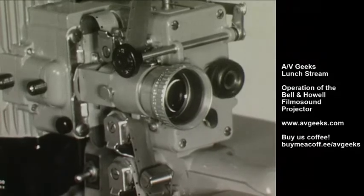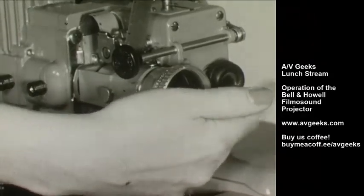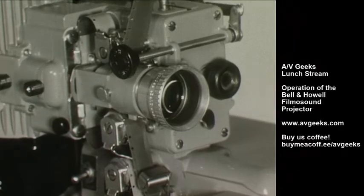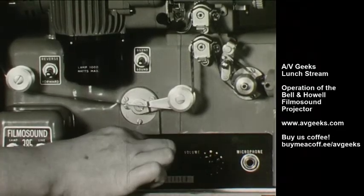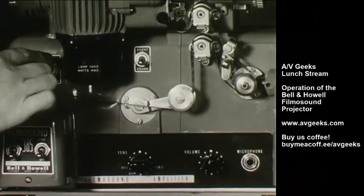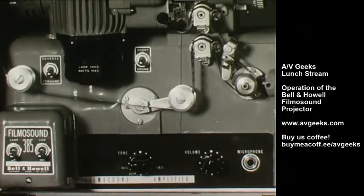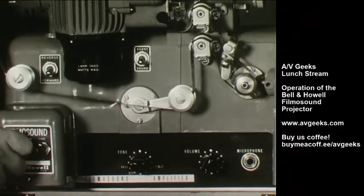By turning the clutch control counterclockwise, the hand setting knob may be used to test for proper threading. Return the clutch control to an extreme clockwise position. When showing sound films, turn on the amplifier switch. Make sure the forward-reverse switch is in the forward position, and that the sound silent switch is in the sound position. Turn the power line switch on, then the lamp switch on.